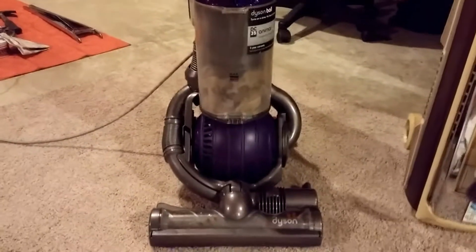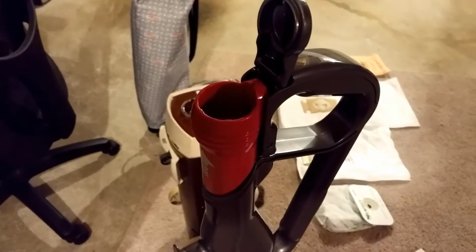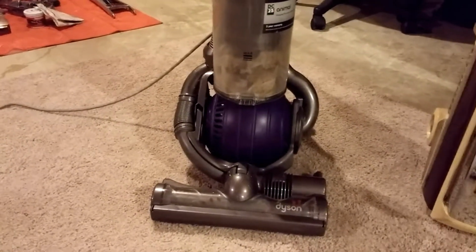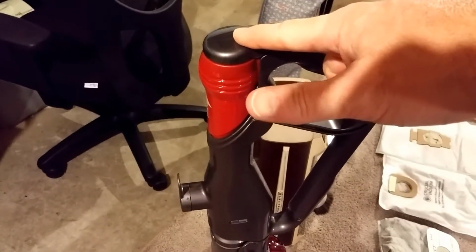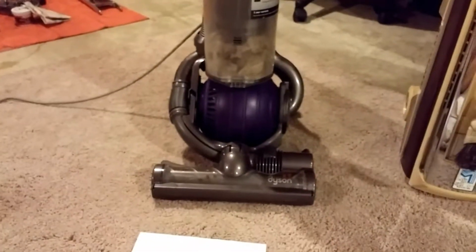So I measured this with this amount of dirt in it. Of course, I know what it does without any dirt in it. And this machine, as measured from up at the top, is 70 CFM with everything clean: filters, you name it, nothing in the bin, and the bin being blown out. And with 2,200 square feet of house, which I think is maybe 1,400 square feet of carpet, and the rest being linoleum, I measured the airflow back up here again, because it's just quickest to measure it up here. And guess what I found? Maybe 1 CFM loss. It was so close, my meter was basically indicating that it had no real airflow loss. You say, what about suction? It says no loss of suction.